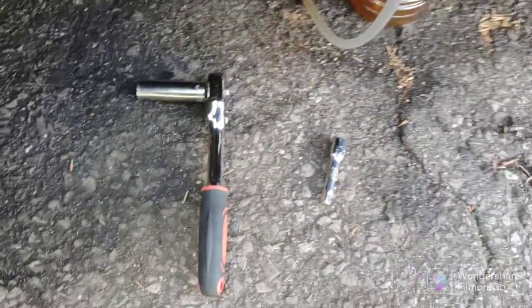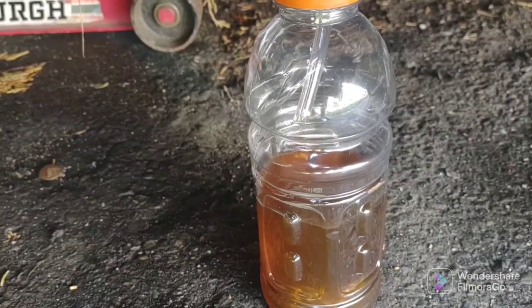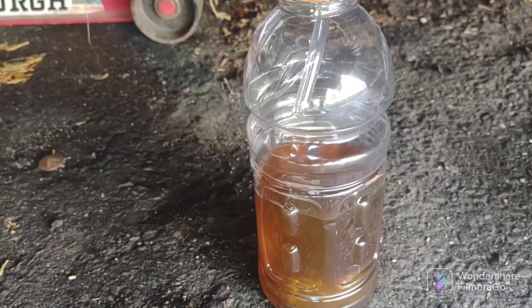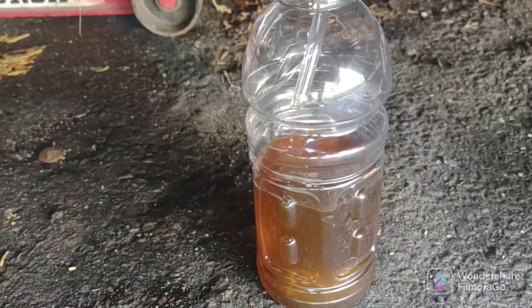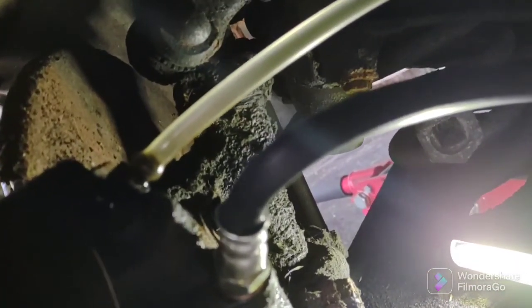Okay, I'm going to loosen this, put the tube on, then spin the tube, which will spin the bleeder, and do the left front. The left front one is really fast. I mean, it's like pouring out. So I've got to keep an eye on the master, because I'm doing three things. You'll only have to do two. You're checking the master and refilling it, and you're watching for air bubbles. But this is a short run, so this should be pretty quick. And you're getting ready to close your bleeder very fast. Get ready to close it very fast.